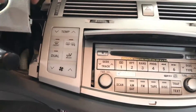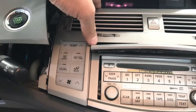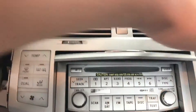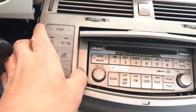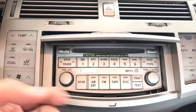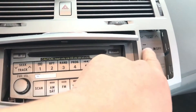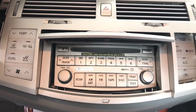I went ahead and removed this panel — notice it overlaps the other. Be very careful when pulling it; grab it with two hands and pry it off little by little. This is very fragile down below, and remember the controls will come off with this too — you'll have to unplug the harness securing that control panel from the back. This one came off without the controls but just unsnapped, so make sure to unplug it before removing the bezel.